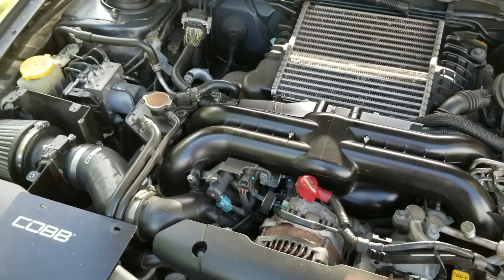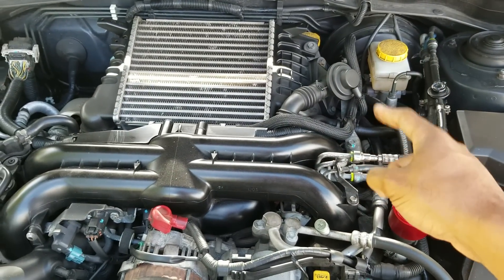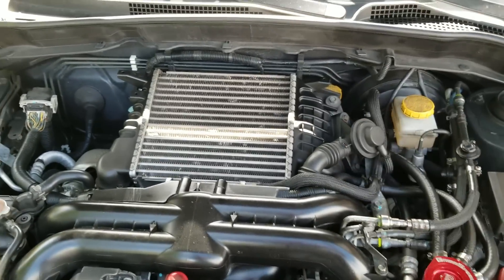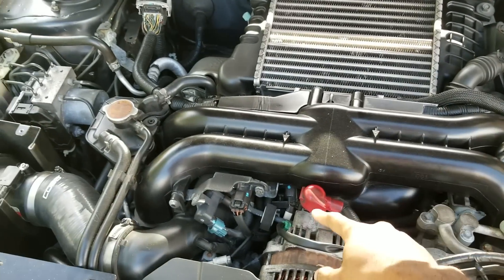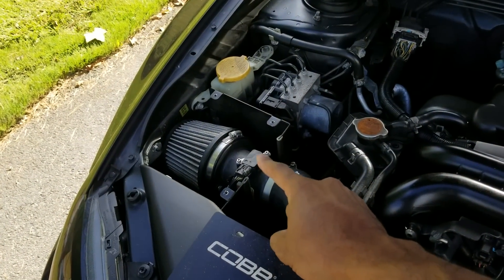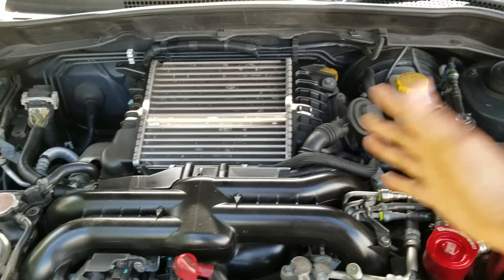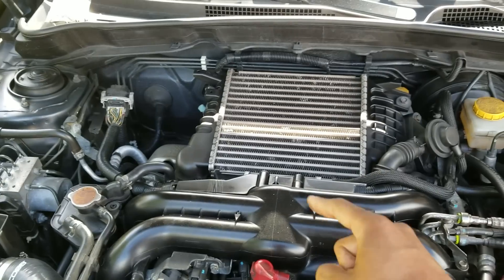Within that split second of shifting — if I had a vent-to-atmosphere blow-off valve — the air gets pushed out and makes that sound. But in that same split second, the engine is still shooting the same amount of fuel it calculated from the MAF sensor earlier. So all that fuel calculation is still the same, but now you've altered the amount of air — you've changed the calculation. You let some air go, so now you've got less air than was calculated, but still the same amount of fuel.